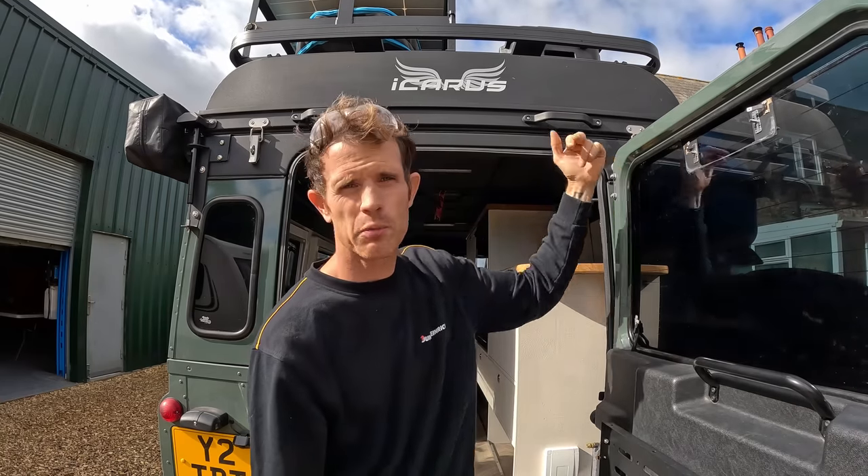While Jess is sewing — the roof rack only weighs 40 kilos and I was amazed at how much it changed the lifting of the roof. If you're putting a roof rack or any weight up there, I'd definitely recommend changing at least the main strut. If you're putting a lot of weight up there like we are, change all six — because even though it lifts fine now, the helper struts at the back pretty much don't do anything. A massive shout out to Kyla, Russ, and Gary who were a massive help in changing these struts.